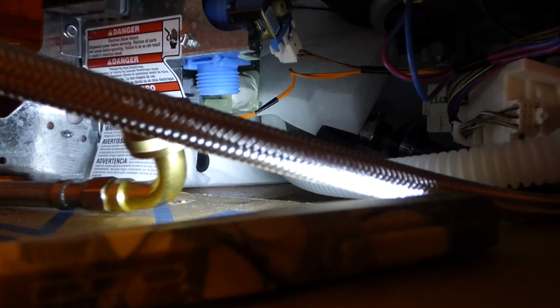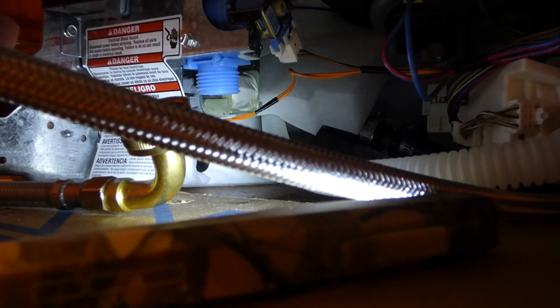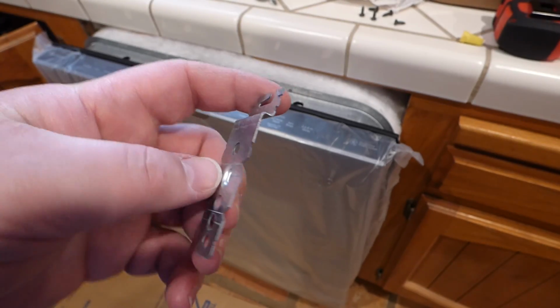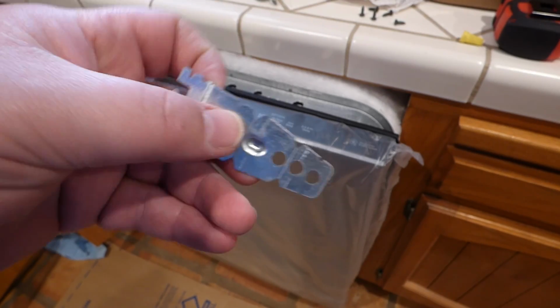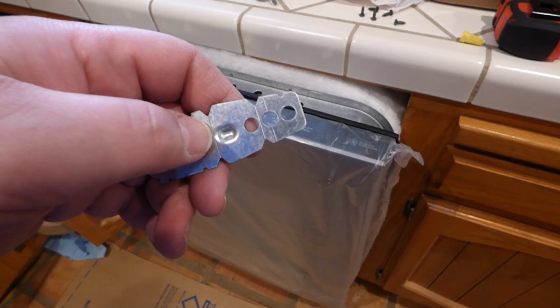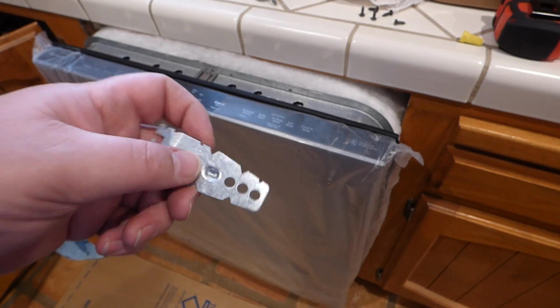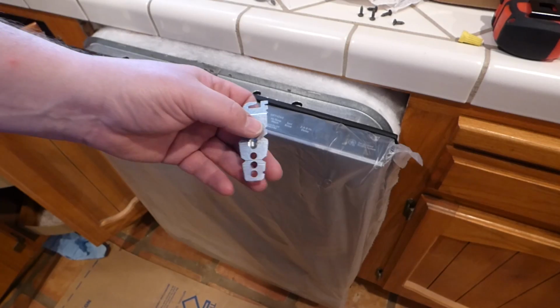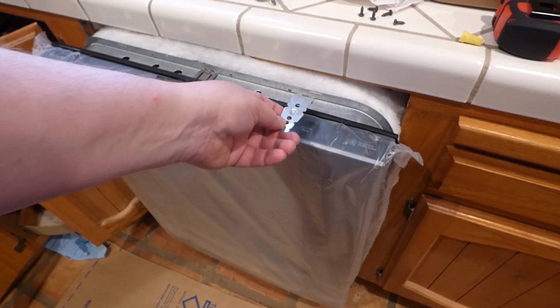Should be able to do it like that, but these low profile ones, they're low. So I'm going to pull out forward and see if I can do the plumbing works a little bit better than what I did here. Alright, so we have this little bracket here, you see. We have these tabs here. They go towards the right, okay? A little notch like that. And if you look closely, there's actually some scoring lines right through these little cutout pieces in case you need to bend and snap off these things. Right, then you get some pliers on both ends of it and just wiggle back and forth till it snaps off. But this right here goes down to a slot in the front of the dishwasher